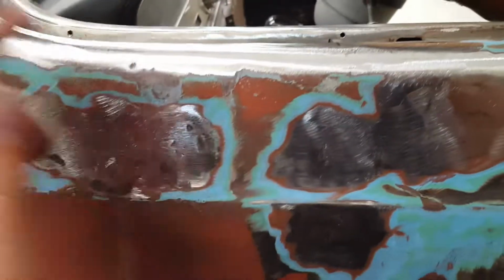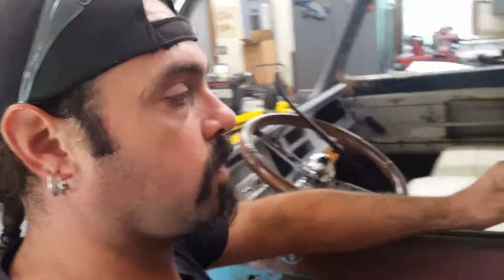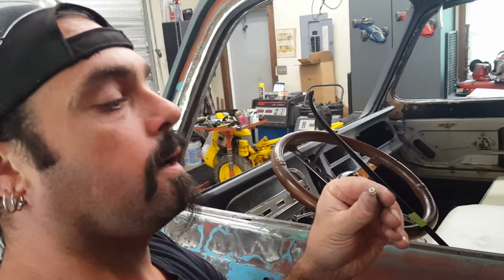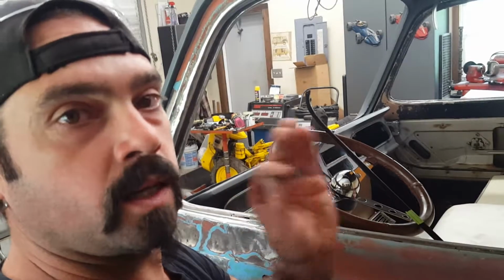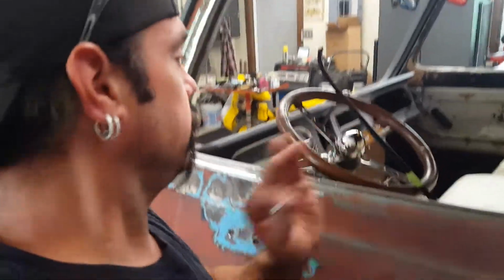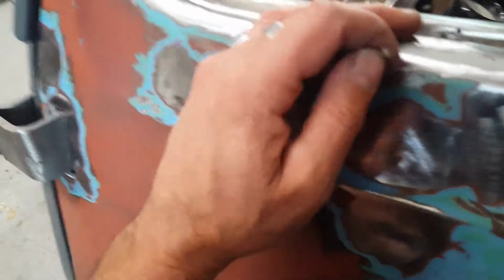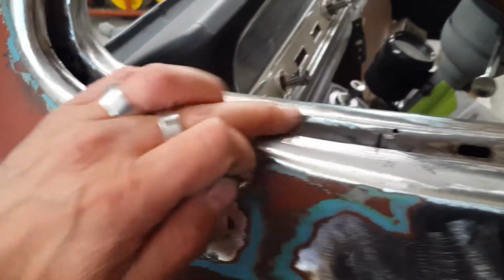Depending on the model of the vehicle, like I did a Pontiac, excuse me, I did a Pontiac and the screws were a little bit bigger than this one. I did see those screws, so I ended up painting them black inside the mohair. And they look good in the end. You never even seen them. So if you run into that case, you have to use a bigger screw. Some reveals require a bigger screw. But in this one, the smallest of the smallest screw, like a number 4 or a number 3, if you can get metric ones, is even better. So that's the follow-up on the video. Okay?